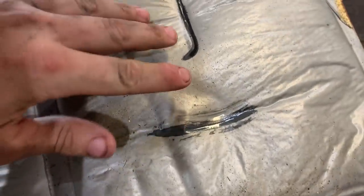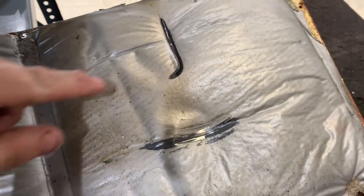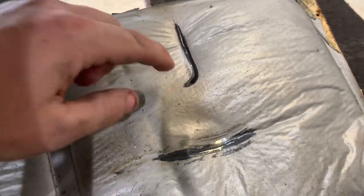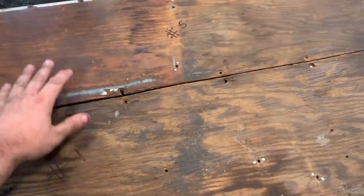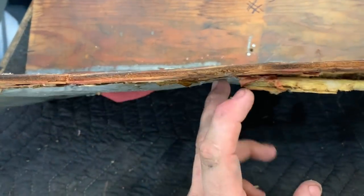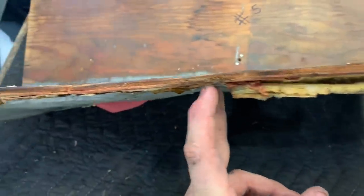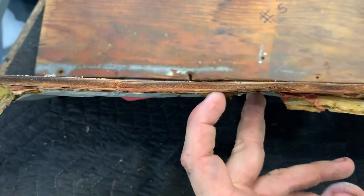As you can see, that's where the two brake lines were hitting the floorboard. The floorboard is actually sagging a little bit when you look at it from the edge, and over time with foot pressure on it I'm sure it sags worse — causing it to pinch the sleeve like that. Right now we're talking about getting part numbers and ordering new panels. This is the pilot floorboard here — you can see where the support runs, and if you look at it you can actually see it go down where the feet are. There's enough deviation that you can see it.